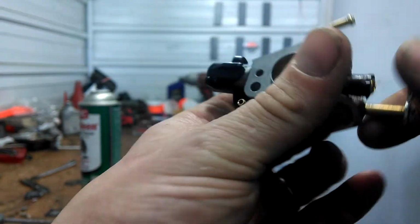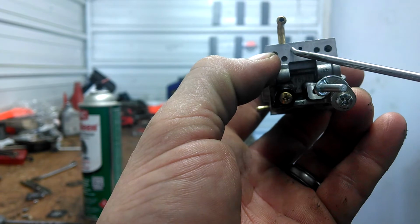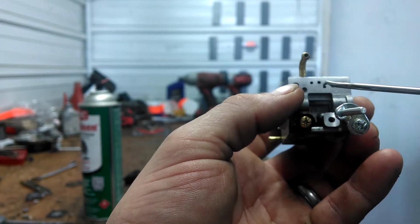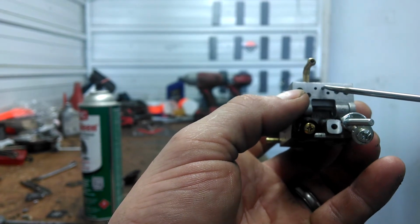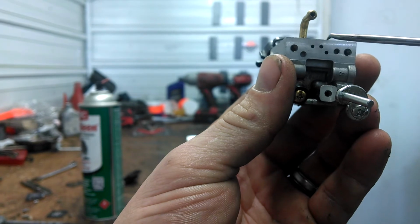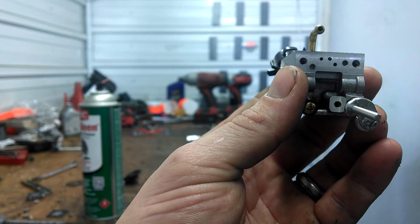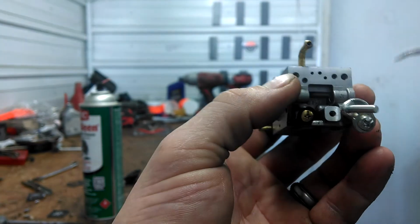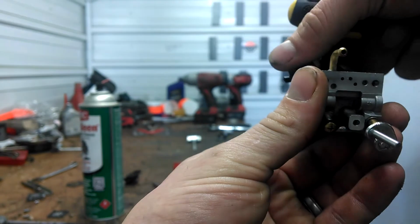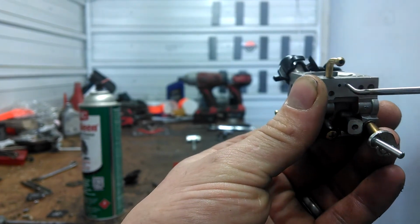On the EL44s and the EL46, the microprocessor sits right here on the side of the carb body. This is where the fuel is fed from, right here. That travels through that microprocessor, and this is a return for the purge, and this is actually the main jet. There's only one hole or path for fuel that it controls how much fuel is fed to the system. Instead of having a low and a high here, you would have just one main low and high. The microprocessor limits the amount of fuel by sensing off of the throttle position sensor, which I have broken off. The computer actually knows where the butterfly is and how to transition the amount of fuel that is flowed through this one main jet, this one main fuel passage orifice.